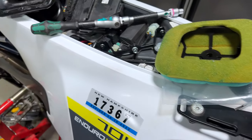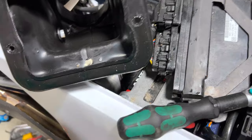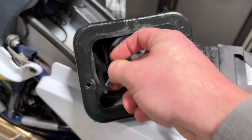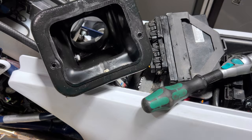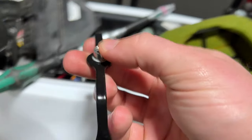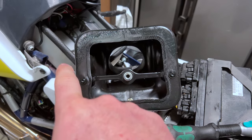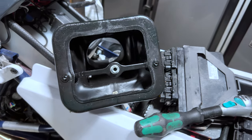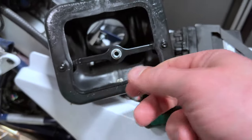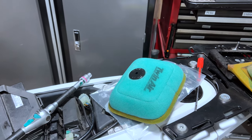For the modification: you're going to be removing the base screws from the old design. So you had these two screws going through like this, and you'd screw into them. No instructions came with this, but I'm pretty sure you take this piece here — the one piece that bolts into — and this is going to sit right on top like this. It comes with these two black screws. I applied some Loctite 243, which is the lubricant-safe one. This goes basically behind the old plastic housing, and now I'm going to put this back onto the little snorkel there and drop it all down.